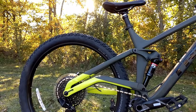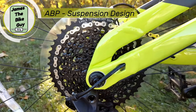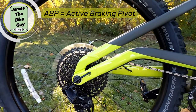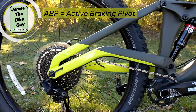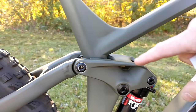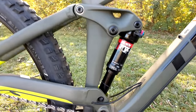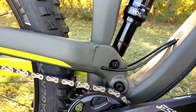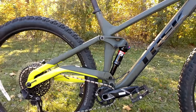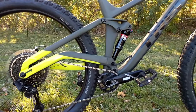Going on from that, this bike is set up with Trek's ABP braking pivot — their own technology for active braking pivot as well as really nice feeling suspension. It goes up across to this rocker link, and you'll actually see everything is moved forward of the seat tube, including the lower mount for the shock. The lower mount presses as the suspension compresses, allowing for quite a bit better pedaling efficiency out of this bike.